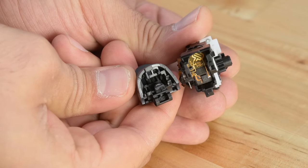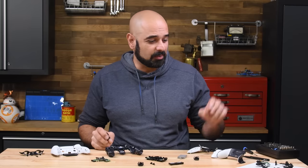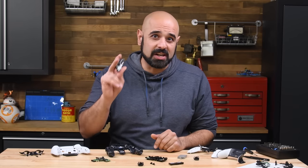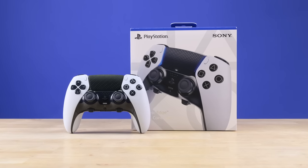That's really going to level up the capabilities of this controller. I've got to say, I really like this controller. The modular sticks in particular are going to make drift a really easy fix. The Hall sensors in the trigger are going to level up the accuracy on these triggers exponentially. As far as repairability is concerned — not bad, Sony, not bad at all.